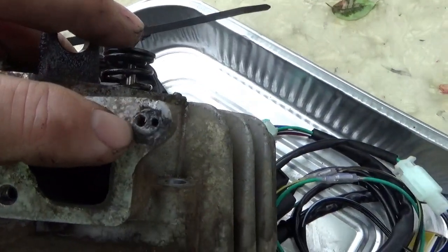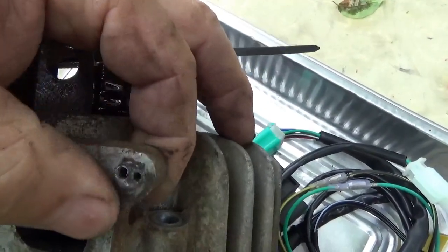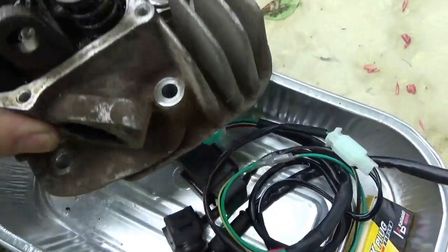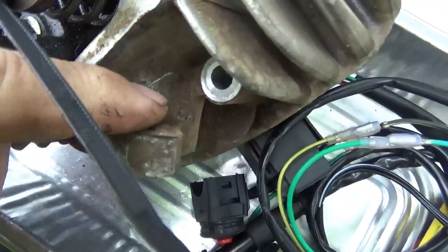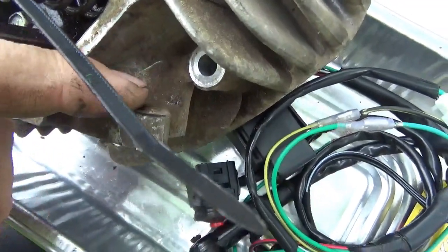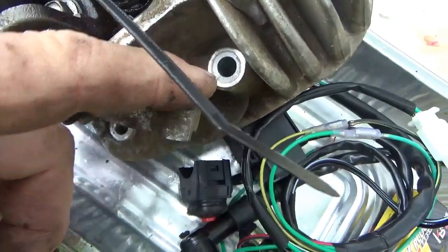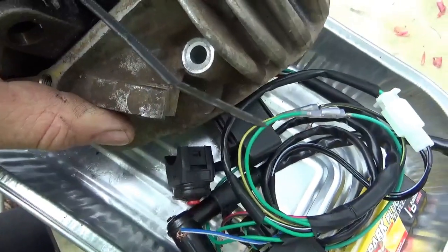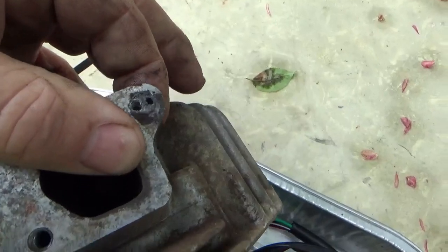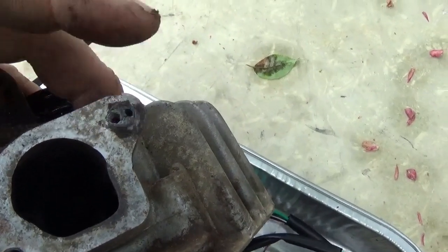In this case, it did not spin out. It broke off, and then you could see there are other problems here. Looking at this, I wouldn't have got into this problem. Once it snapped off, I would have just cut it flat, center punched it, and drilled right through. Then I would have followed up and put a nut on the back. And to make things even more interesting, this extra material is JB Weld. Anyhow, we've got to fix this up.